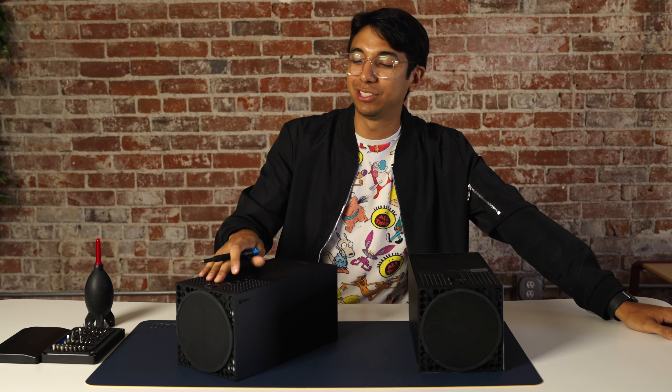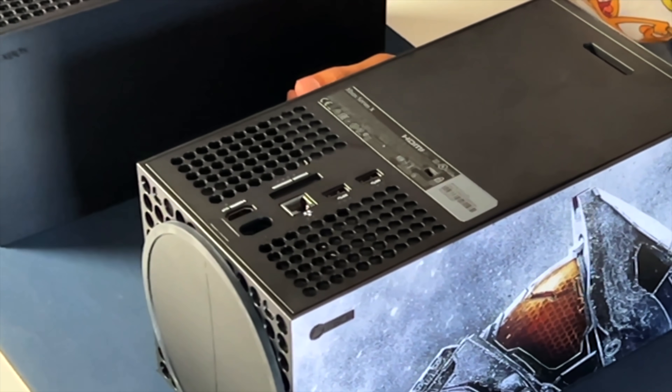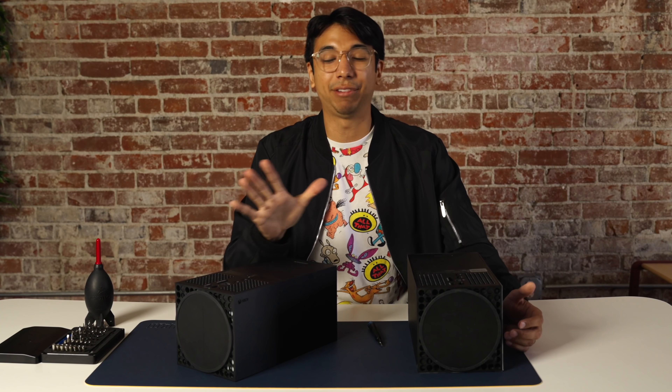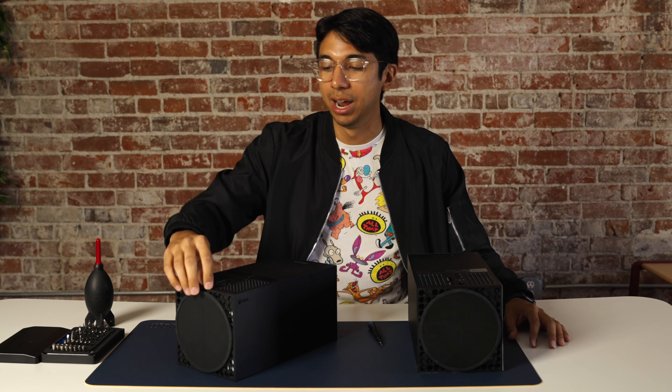You may recognize this clean one as the one we were slapping a bunch of wish.com accessories on. My personal one is crazy dusty. On the back of your Xbox you'll find a couple stickers — one with HDMI info and a barcode. You have to peel that off to reveal a secret green screw. There's another one at the bottom of your Xbox right next to the base — peel that off too. You'll need to undo both to crack open your Xbox Series X. This is a T8 screwdriver — you need this specifically. Do not try to use any other screw heads or you risk stripping them.